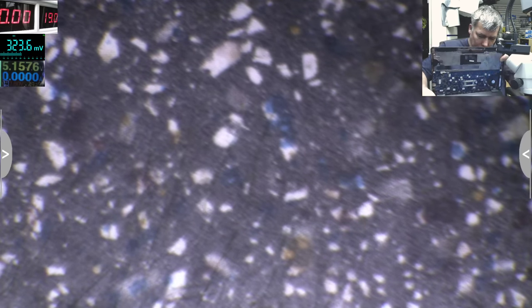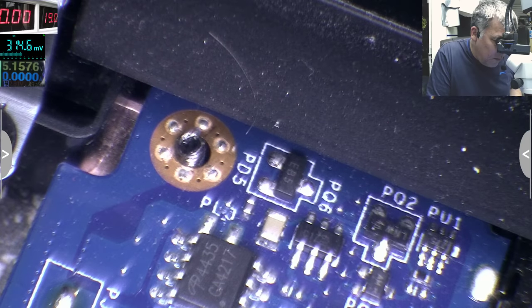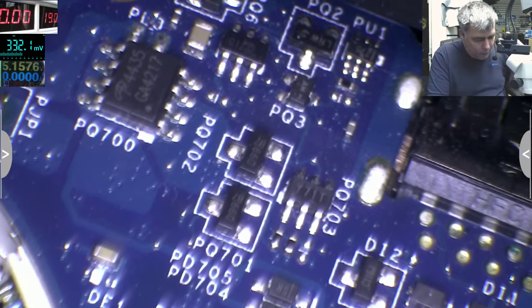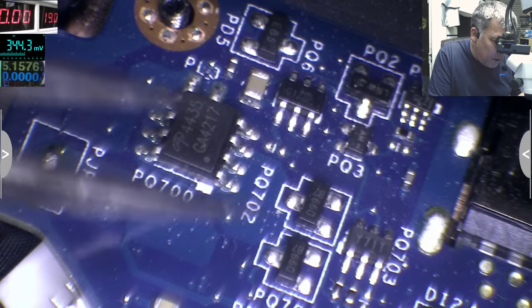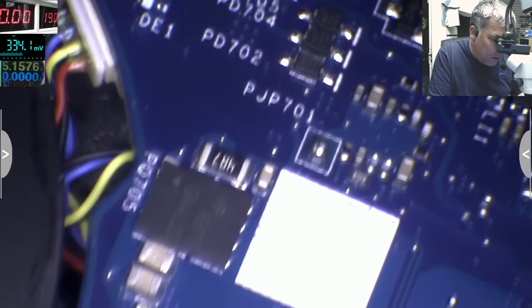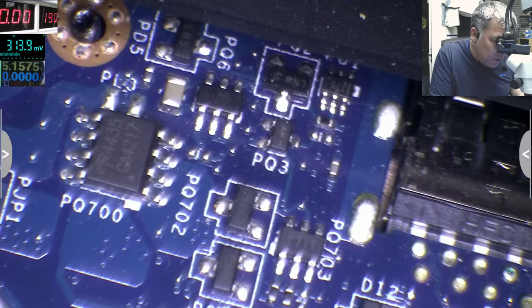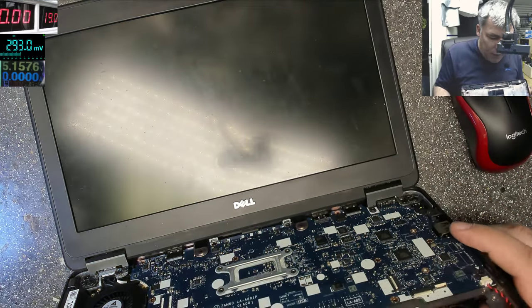Let me see. How is the connector? The connector is there. So I suppose. Okay, this is a bit different from what we are fixing. So here somewhere, probably it's a plus. It's the main power rail which is coming on this MOSFET. It's going out somewhere, but I can't see the second MOSFET. This is part of a power supply. Possibly we have to take the motherboard out. But let's try to see exactly where the charging port plus track is going.